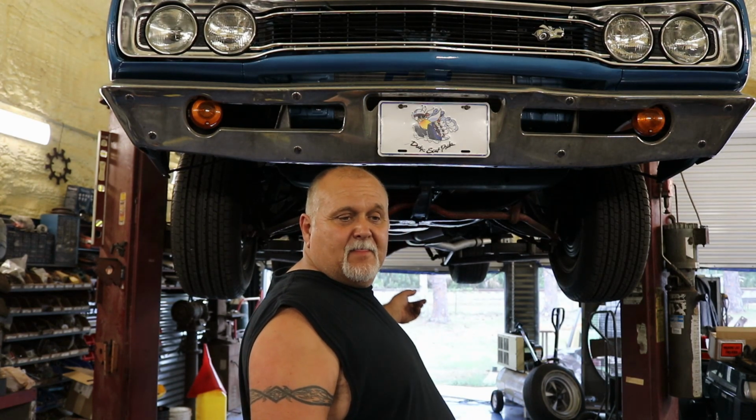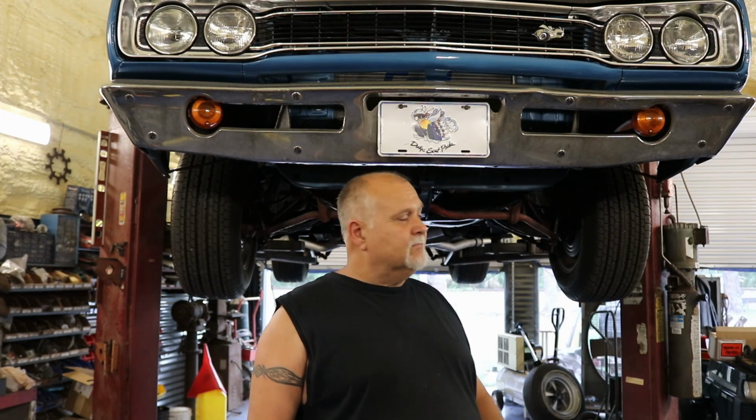Next step is right now in the car, I've got this really tall gear that I use just for driving around, save some gas. It's really too tall for this car. So I'm gonna put my 355 gear back in it, but I have to change two gears around because my 355 is on a locker and I wanna take it off and I wanna put it on a limited slip, which I have a 411 on. So I'm gonna swap the 411 and the 355 gears with the locker and the limited slip. So I'll have the 355 limited slip in this one. So let me get started on this rear end.